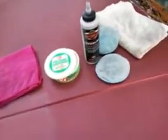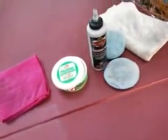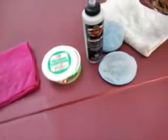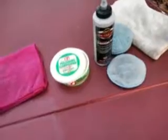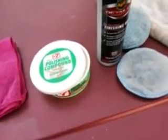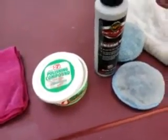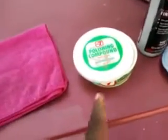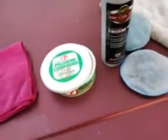Now, I know you're going to run into some cars that have been sitting around. You might even buy one where the paint has dulled down, and you don't have all those fancy DA polishers or rotary buffers, cutting pads and all that stuff. A lot of times, guys, all that isn't needed when you're doing paint corrections, but people won't tell you that. A lot of times you could use aggressive products, like a polishing compound, which has the polish and the compound all in one product. You could top it off with a finishing wax of any kind, as long as it protects your work.